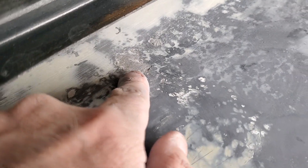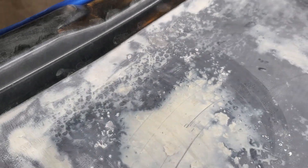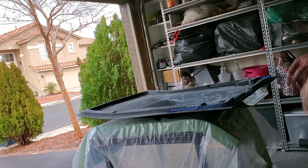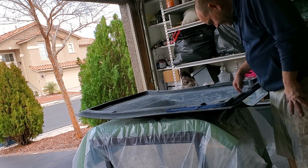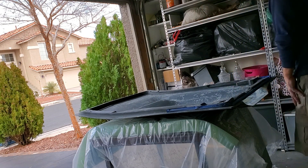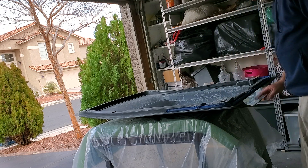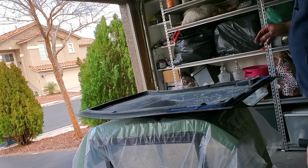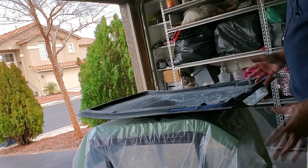I need to fill in a little bit right there. That's from that fiberglass filling up the paint a little bit there. So I've got to fill in just a few more tiny little areas and then sand the rest down. Initial sanding is done. I put the glaze down right here and up front. Then I'll finish sanding it down, get it nice and smooth all the way around, wet sand it one more time, and after that put on the primer filler.